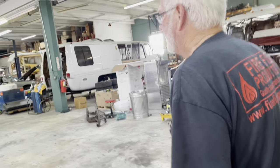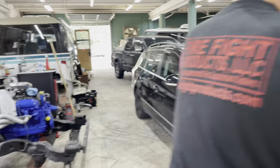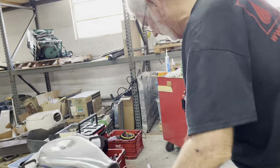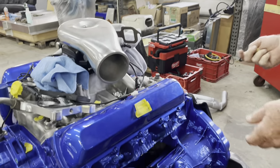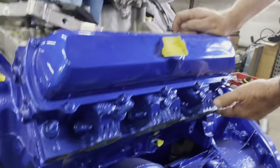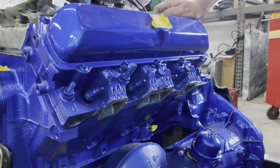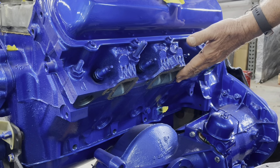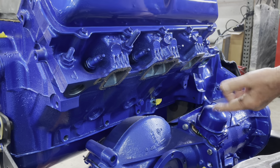What's this Volkswagen doing in the big house? This is Annie — she's also a GMC owner. Right here, this is one of our test stands. The header would normally be here and it's taken off. Because if you have headers on your coach, to get the governor out you've got to take the header side off. Now if you have manifolds, you don't have to, but manifolds are getting rustier and rustier.